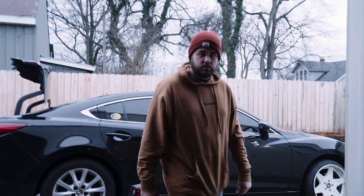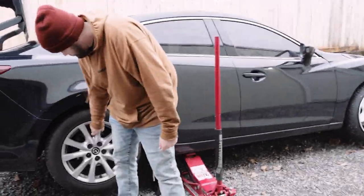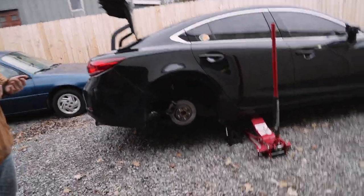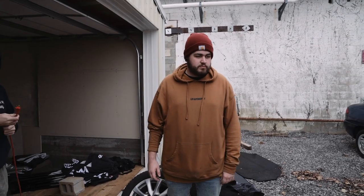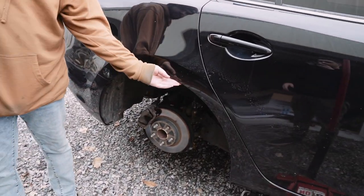Also doing some Riverside prep — you guys haven't seen this thing yet. This is Michael's Mazda 6 with the LS207s, just got these wheels on there. Need to try to get the rears on but we gotta do a little bit of rolling. Personally I would just shave it because the rear you don't have to worry about it — you don't turn in the rear — so I'd shave it and go from there.